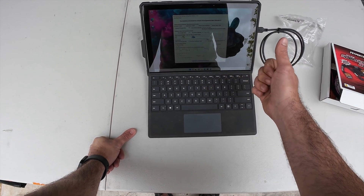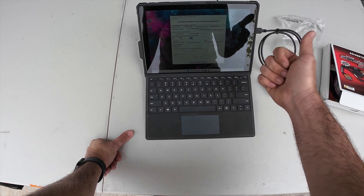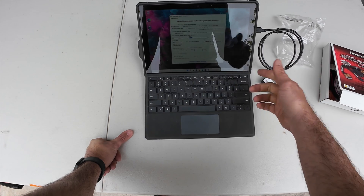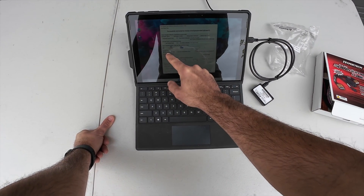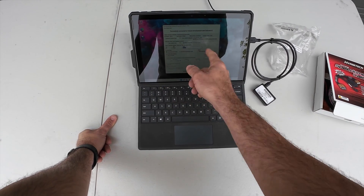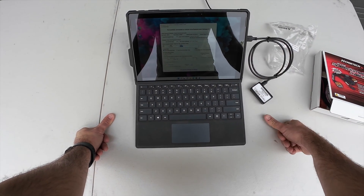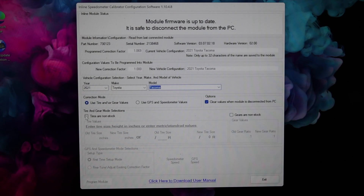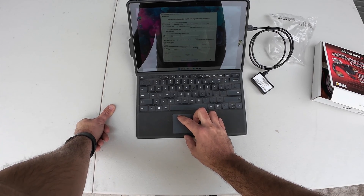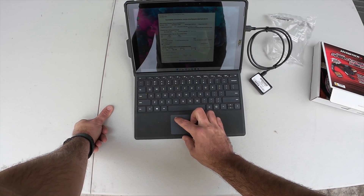One thing I didn't explain — if you upgrade your tire size, this is good for that. If you also re-gear the vehicle, this is good to change the calibration for re-gearing. So on this one, you can use the factory tire size, or you can choose to adjust for a new tire size or gears. I'm going to check the box that says tires are not stock. It's going to ask for the old tire size, and then it's also going to ask for the new tire size.